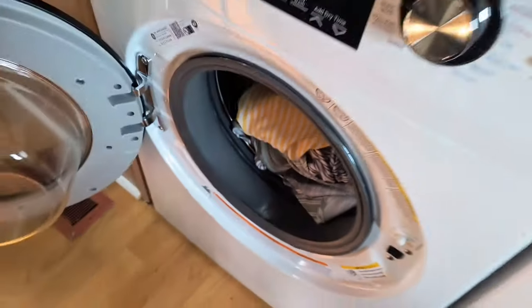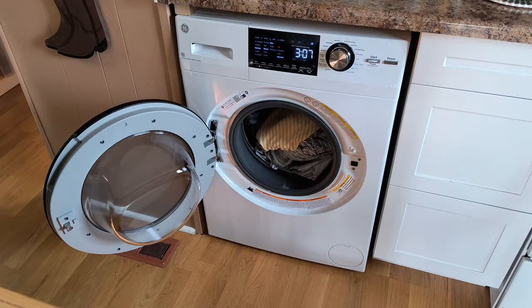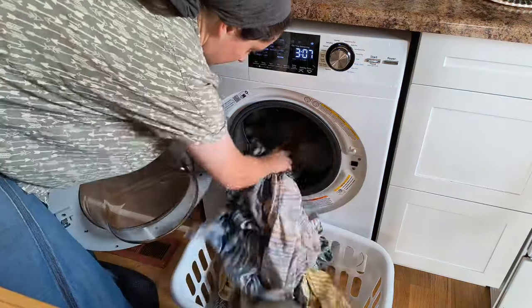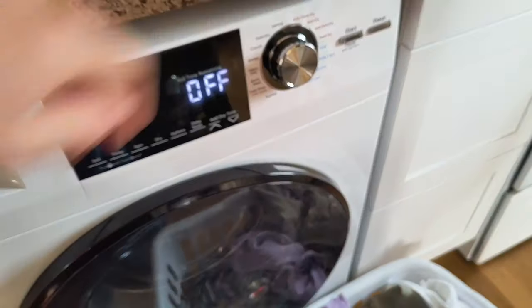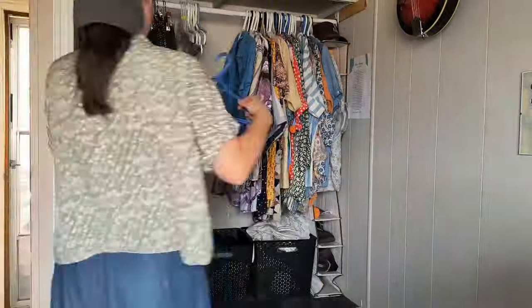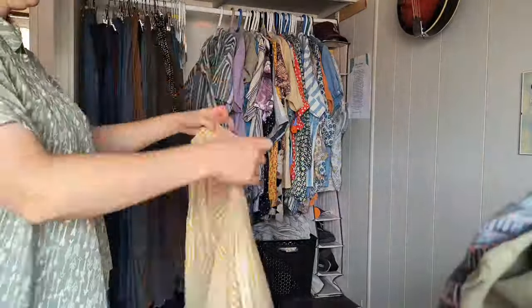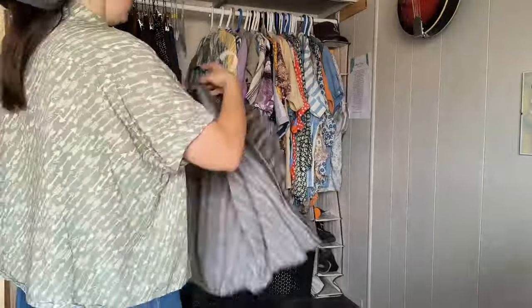If I were only washing, I could do another rinse and spin or just another spin. There can be times when the unit may not be able to balance the load and spin up to full speed — if this is the case, you can do another spin. These seem to be perfect, so I'll hang them up. If you are drying clothes in the machine, you will want to take them out as soon as it is done, because when they sit in the machine they tend to get damp as it cools down and humidity from the heat falls on the clothes.